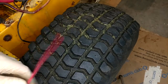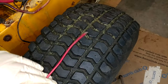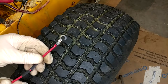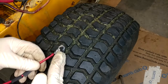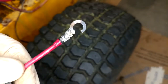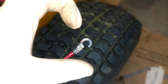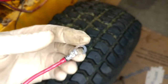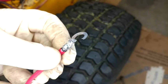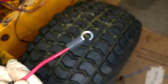I decided to take a quick minute and make up the ammeter wire just to have it checked off my list, then discovered I don't have the proper size materials. So we're going to talk about doing the wrong thing the right way. What I have is the most suitable ring terminal I had — which was too small — so I cut it right there and opened it up a little bit so it fits on the stud on the starter solenoid. If you're going to do something like this, cut it open on the side that's going to want to close as you tighten things down. When I put this over the stud, I'll put it on just as you see it so as the nut goes on it'll draw in tighter instead of opening up and falling off. I also soldered that on after I crimped it — it's going to be a fine connection and it probably won't give me any trouble. After we shrink tube it you won't even know what happened once it's installed.